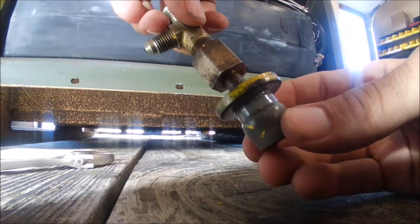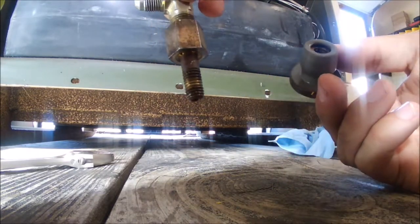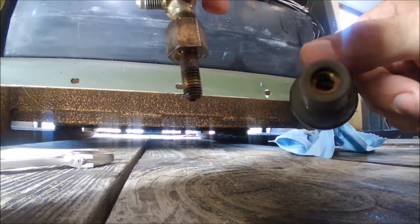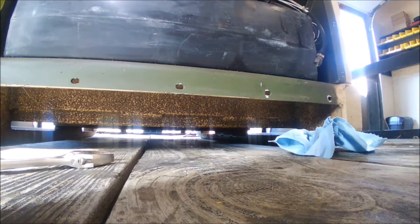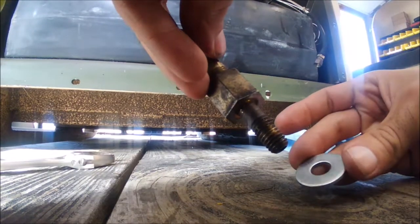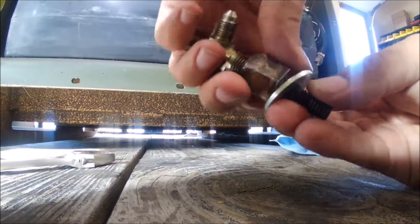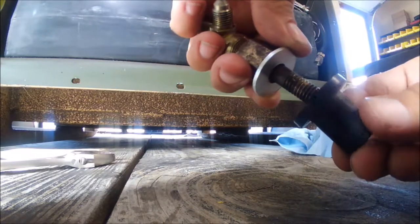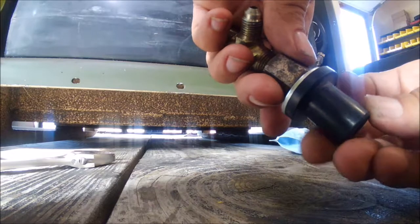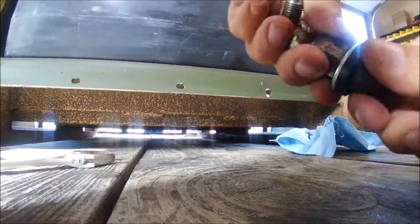Here's the old way it was assembled — not entirely improper, but the washer was missing and I don't believe this is the correct rubber, so it started to break down. You can see the brass nut in there sort of pulled up; it didn't stay tight. In my hardware I had this washer — it goes on there. You want to make sure that the washer is not any bigger than the diameter of the top part of the rubber nut, and it gives you just enough to snug it up by hand.